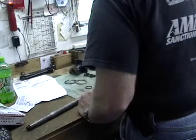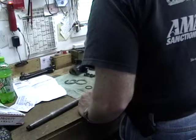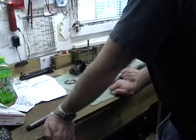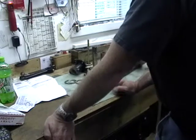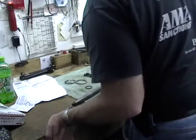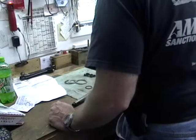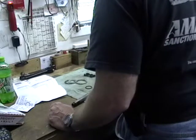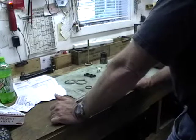The book tells you to assemble the whole thing and then adjust it. Yes. I found, with mine and Fred's, I'll take the empty steering box and the sector housing. Put the sector shaft into the housing, bolt it down to the box, without the worm. Then we can go and adjust the preload on the sector, lock it down.